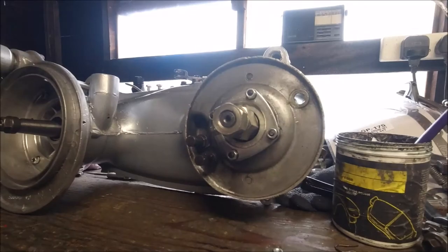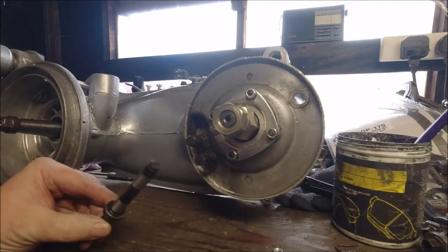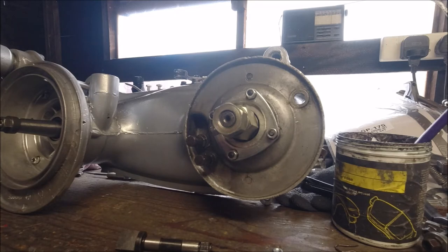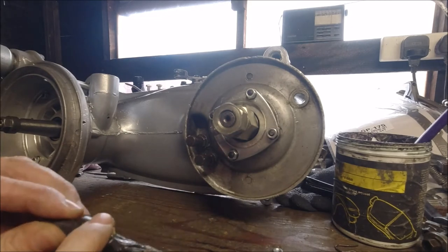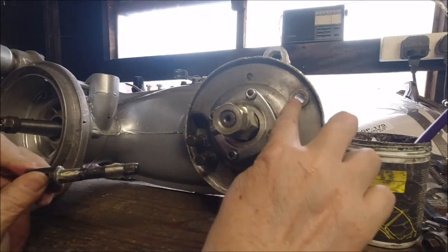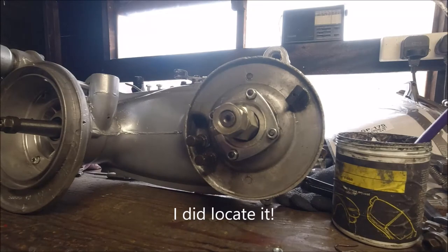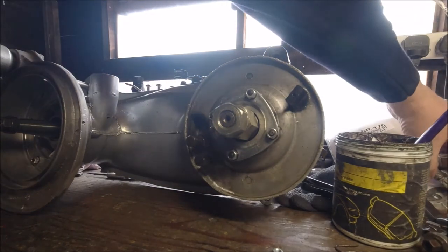We're going to be using the GP cam, which goes in there. Before we do anything, it's got a little shim that just packs it off. We need a little bit of normal multipurpose grease — put a dab around the end and put our washer-shim on. We want to fill up in there with grease and on the axle itself, put some on there as well. Push it in — moves nice and freely — then get our brake shoes which I've already had on before.